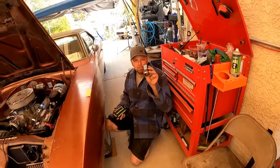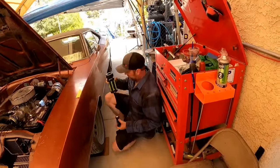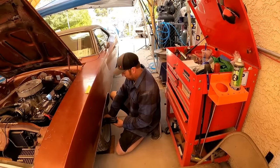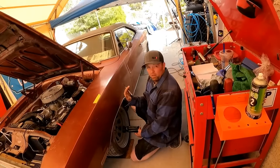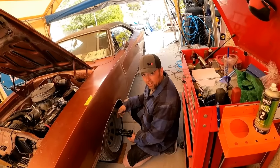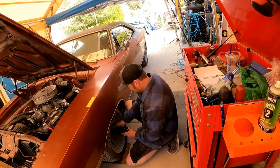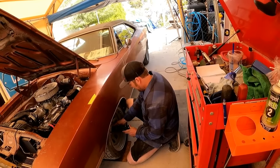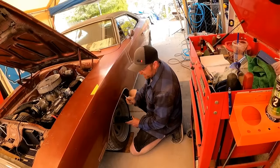So I've got my eBay special, and I've got my favorite Longacre bubble gauge. Let's just see what the Longacre has to say first. I've got the steering wheel centered, but I don't really know what the toe is, and so the wheel looks fairly straight, so I'm just gonna go with that. And see, I have 1 3/4 degrees of negative camber.